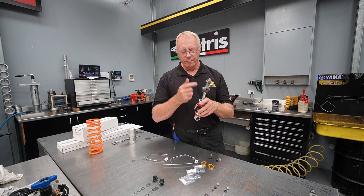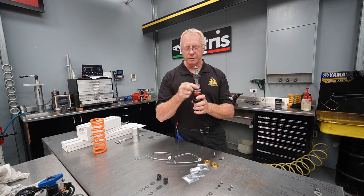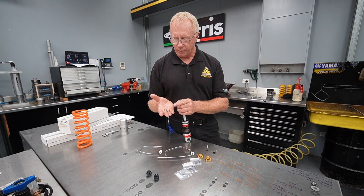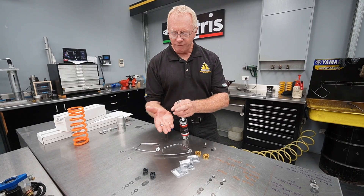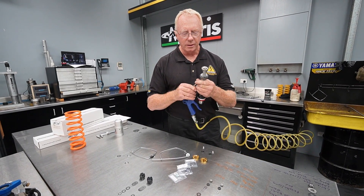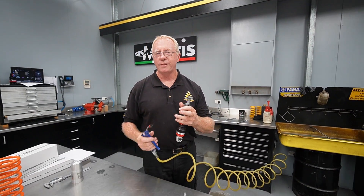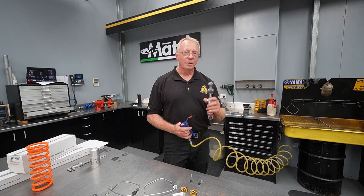We've reassembled our shock shaft — we've made valving changes, modified the rebound circuit, and increased the bleed size within this shaft assembly. Here is the secret sauce we actually use with this particular shock: we have a little shaft extension that allows us to get a better swing arm angle than what we'd get from the conventional shock, giving us better drive capability. This little step washer here — we put our valving on that, and it allows us to still valve up this rebound circuit, but more importantly it gives us a little bit of clearance so that when it goes to activate we can simply put a bit of pressure in there and you can see that valve lift.